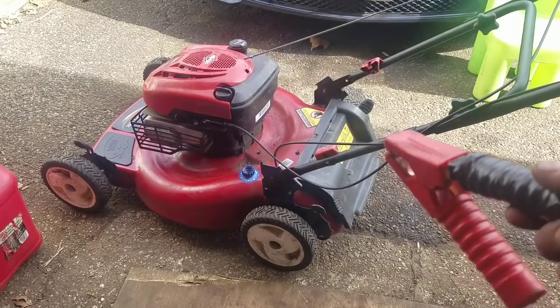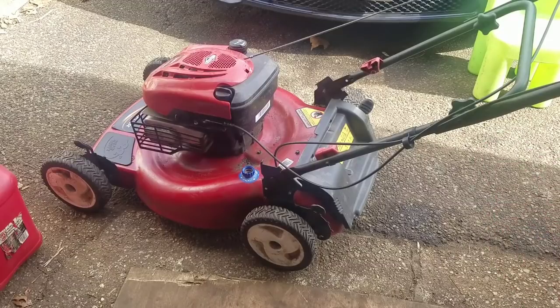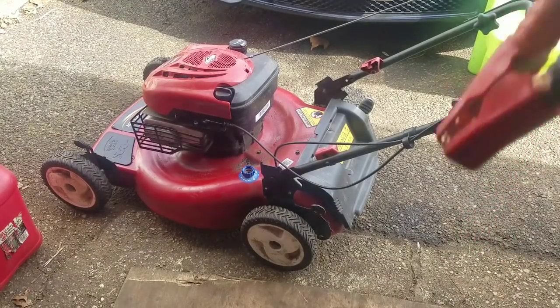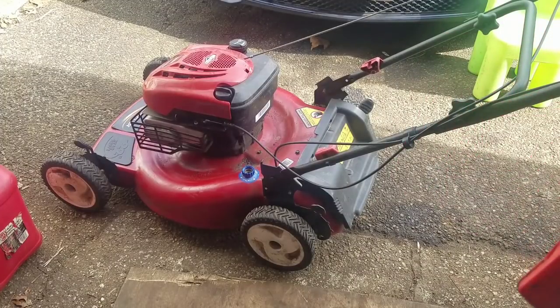The only thing wrong with it is the transmission. We looked at the gears and it looked like they were not rubbed out. I think it's just that they're not touching, like it's missing some kind of washer on the gearbox that allows that top worm gear to get to the cog. It seems like they're not touching. They're not even rubbing against each other.